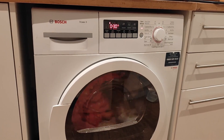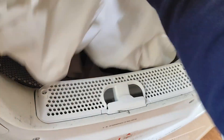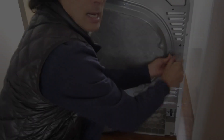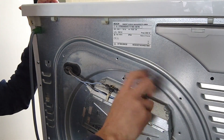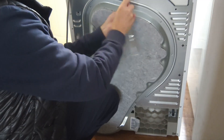The result was: the first run — no stops, success. But the second run stopped once. The third run didn't stop all the way through. I didn't feel I had fixed anything. So I went back to the back of the tumble dryer with the intention to make the other five holes bigger — from 3mm diameter to 5mm, which is about 2.8 times bigger holes for the intake. The result was still the same — it still stops. So I didn't take another video of stopping the machine.